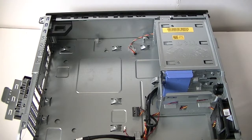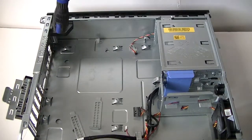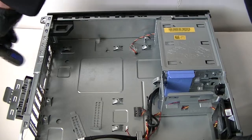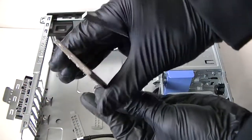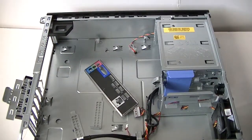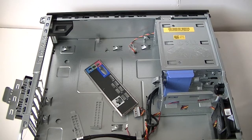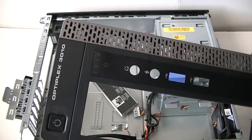The last part — remove the PCI brackets right here, get those removed. There's an I/O shield back plate in the back; just tap it with the screwdriver and it comes right off. Be really careful — it has sharp edges, you can get cut quickly, so make sure you're wearing latex gloves. There's also a fan in the front but I'm not removing that. We've basically taken down the whole machine — nothing is left inside. Thanks for watching, bye!